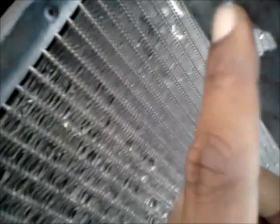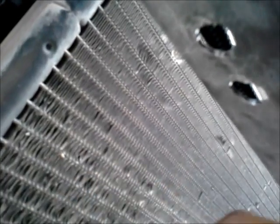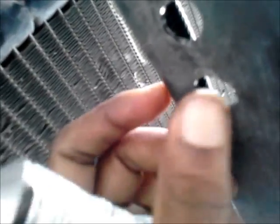All right. So look, I drilled the holes, right? But the thing about drilling holes is they leave bare metal. See that? That's steel right there. So the silicone is to put a barrier or membrane between that bare metal and the bolt itself. What I'm trying to eliminate is rust. The more I can keep rust to a minimum, the better.